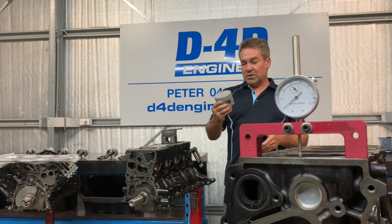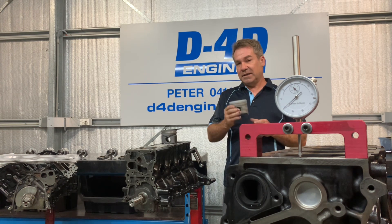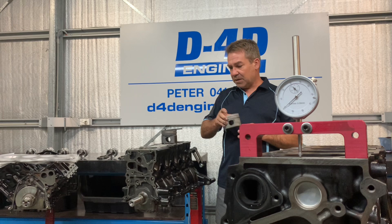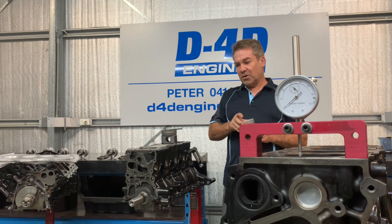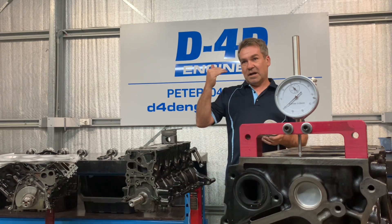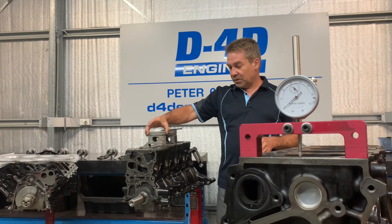Back when people were choosing head gasket thicknesses for this, the biggest thing people would worry about is thinking the piston was going to hit the head — which would have to be extreme for that to happen — but that's what people used to panic about. So it sort of came in that people would just throw the thickest head gasket on and see how it goes. With the 2.8, it's pre-common rail where they're just putting as much fuel in as they can — not a very efficient style.